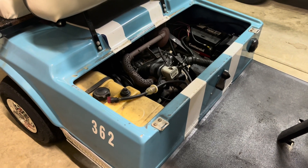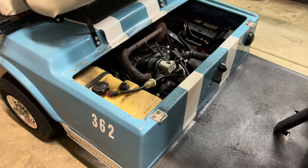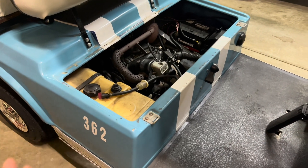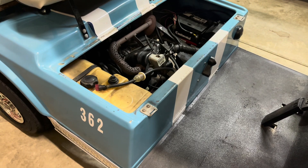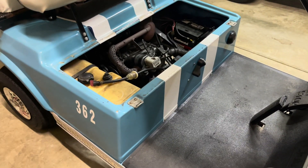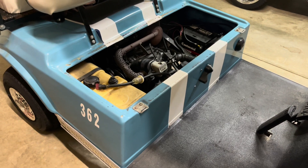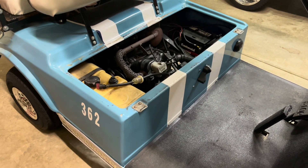All right YouTubers, that's it for the head gasket replacement — no big deal. Everything lined back up, went in just like I expected. Tightened everything down to 18 foot-pounds, and now that we're done with the project everything's buttoned up and ready to go. This completes how to replace a head gasket on your Club Car DS FE290. If you liked the video, like the video.